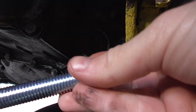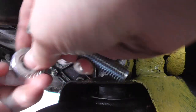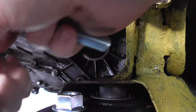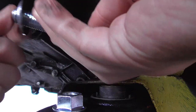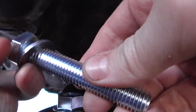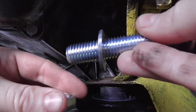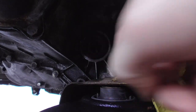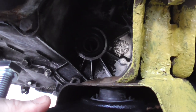So for here I've got some new bolts — I've got some M14s over 80mm, and then I've bought some new flanged bolts, and I've also got two washers. The other ones had a flanged section, so what I'm doing is sticking a washer over the bolt to give more surface area, and then underneath, of course, I'm going to do another one followed by the flange bolt. That's going to go into here into the hole, and then I'm going to do one on the other side over there. Let me just re-line this all the way in.